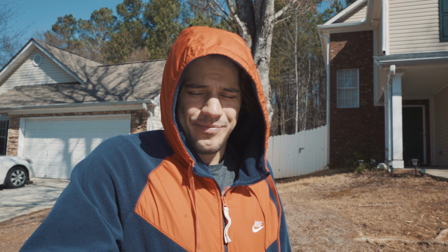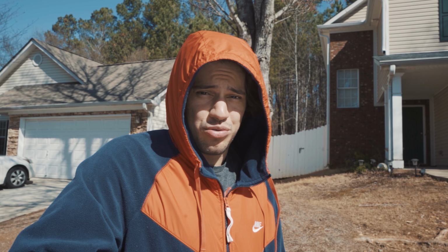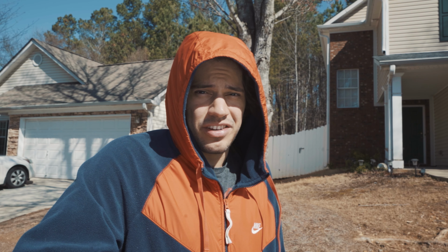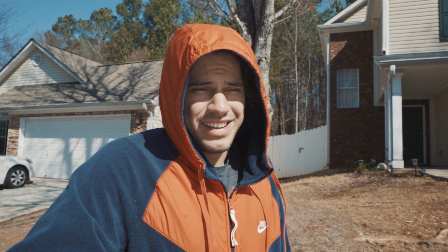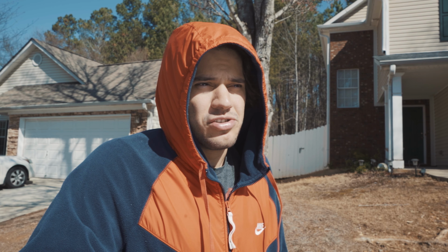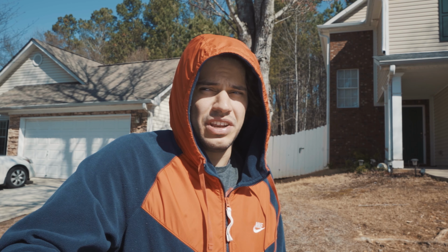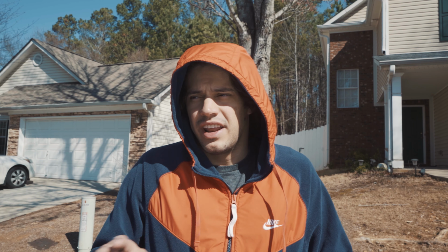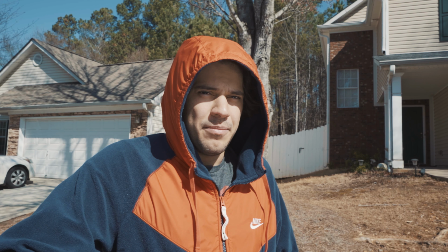So right now I am going to top off the fluid and go for a drive. Keep the coolant and the water in your car when you're doing this, because you might need to pull over and keep topping it off until, like it says in the video, once it's maintained, you've been driving it for a while and the temperature doesn't change, you're good. But you need to keep watching for the next 4 days after you install your new radiator. You need to keep watching your fluid level just in case it does go down again. But so yeah, let's get to doing this top off.